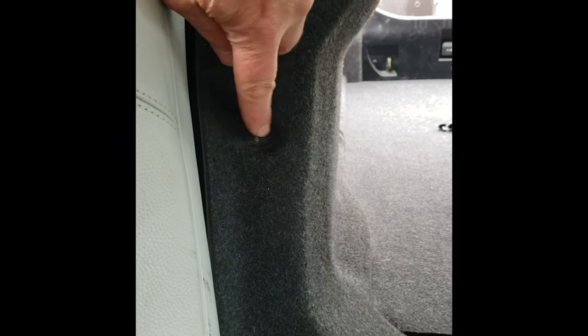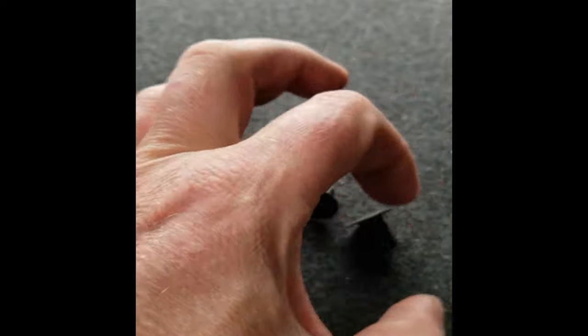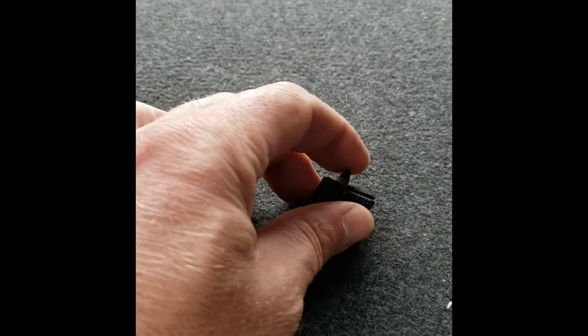Okay, so I was just able to pull out a couple of plastic rivets, one here and one at the back in the top corner there. Those are fairly easy to get out. You just take the center pin out and then the rivet comes right out. If you try to pull this whole thing out as one piece, it's not going to come out. And then that just gives you enough room to pull this aside, and we can sneak right into the back there with the cable. Nice easy path to follow. So I'll go ahead and route that in there and I'll see you in the trunk.